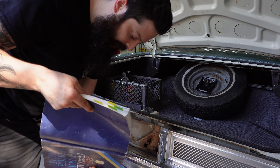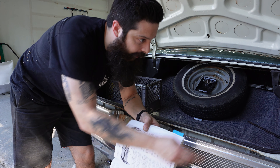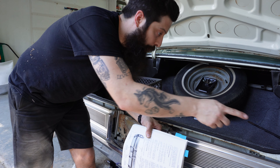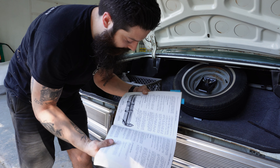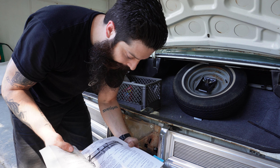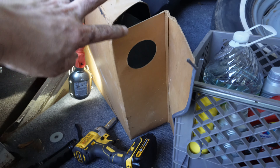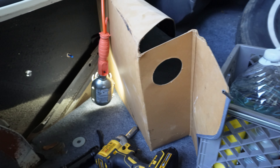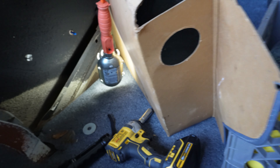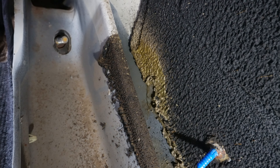I checked the other page in the book, and it says if you want to remove the bumper, there's actually two bolts up here at the top. And it also said to put down some jack stands, so I did that too. Behind this trim — really it's just cardboard — there is actually a hole cutout here to get to it. You can see there's one little guy back in there that seems to be holding this whole thing up.